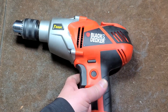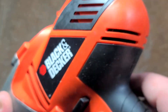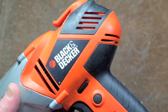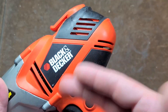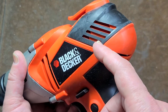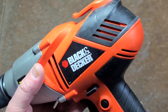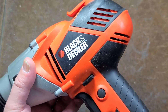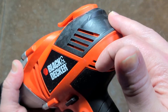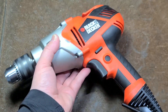You do get a midship handle here. The reverse switch is very stiff. It has a reversible brush card. Brush type universal AC motors have essentially a timing known as magnetic slip angle. When you run them in reverse, it reverses the relation of the brushes to the field winding — that's how it runs the motor in reverse — but the slip angle isn't quite the same. You can lose 20% to 30% of the power. Most drills lose 20% to 30% power in reverse unless they have a rotating brush card, which physically rotates the brushes to maintain proper slip angle. So this drill belts out full power in both forward and reverse.